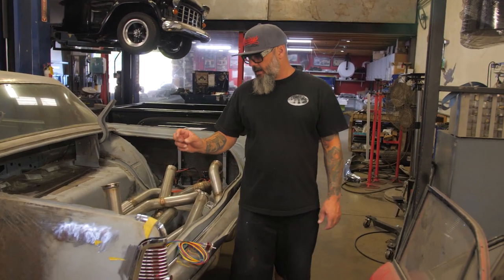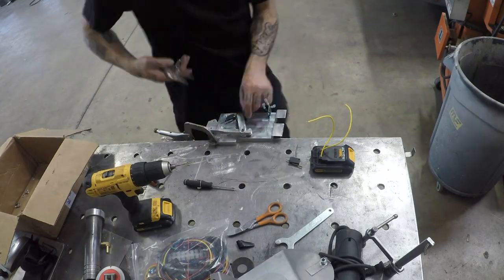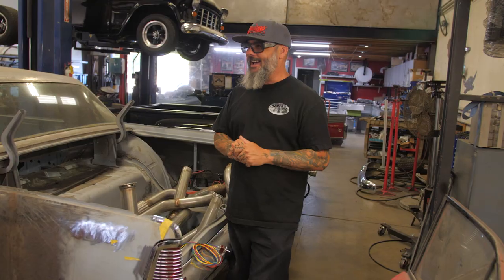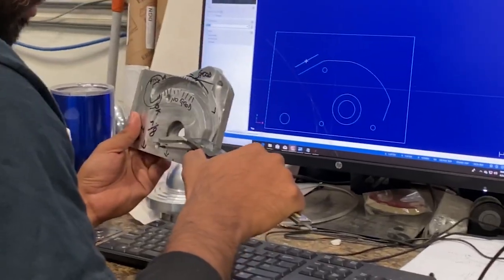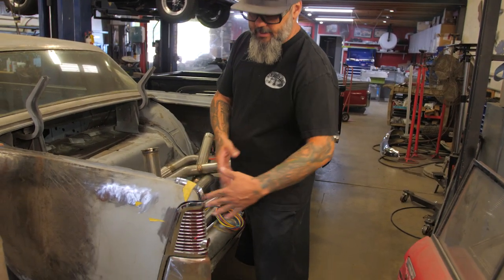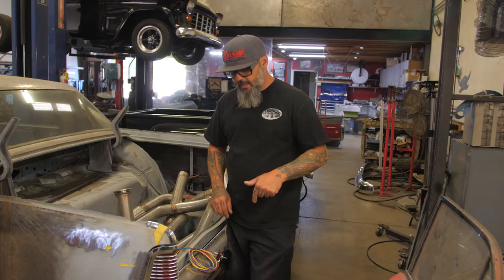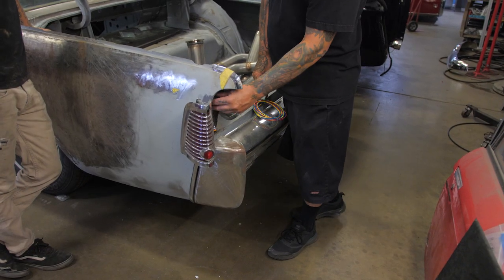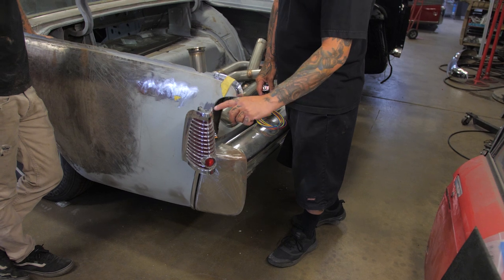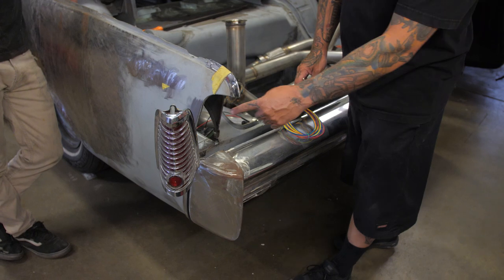We ordered an electric hinge kit for a '55 Bel Air. We thought we might just modify it a little bit, but that turned out not to be the case. So we ended up recutting the whole plate and changed the track width. It's still very similar to what they have, but our tail light the way it fits in the corner doesn't allow it to go right. This is not adjusted 100% yet, but it's really close, and I can show you today how it works. Once it's dialed in, it will open like this, and the filler neck will be right here. So when you want to put fuel in, you click it on there. Keep in mind, we don't have a rubber gasket on it — we haven't finished it all, it's not fully aligned, but it's all adjustable and ready to go.